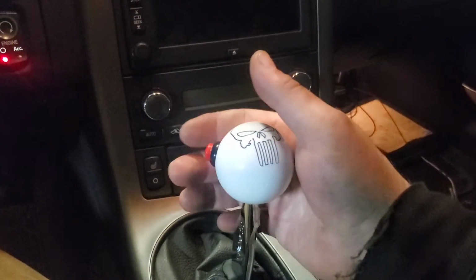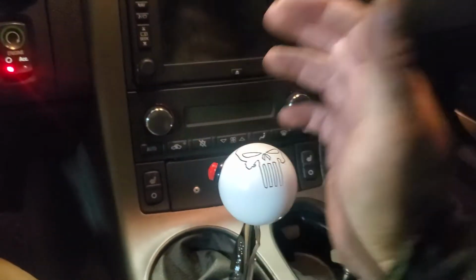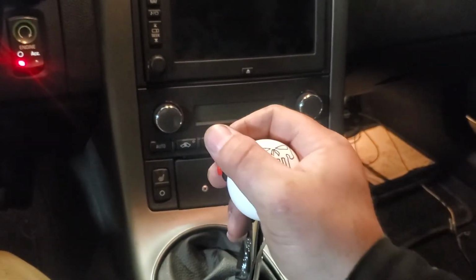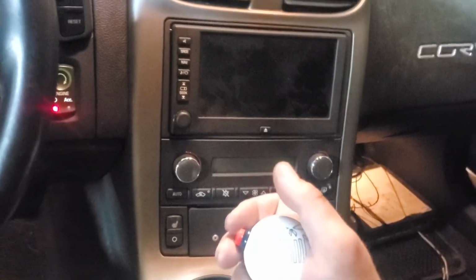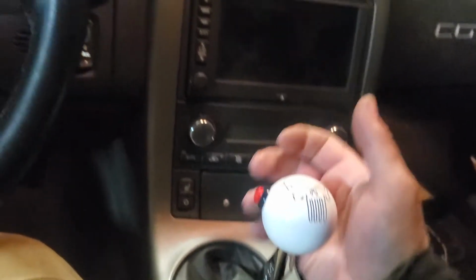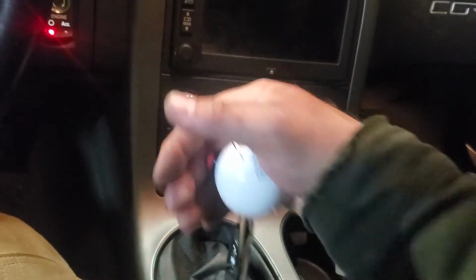And then here, this used to be for nitrous. The LS7 had nitrous on it, but I never really used it. Not in a race anyway. This is for the two-step. I set it at about 4,500 or so. It works pretty good. I run two DR2 Hoosiers, and they stick really good.